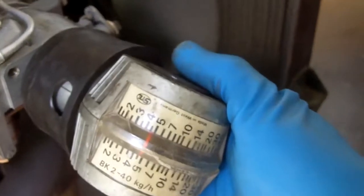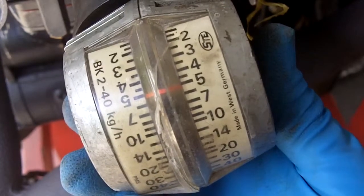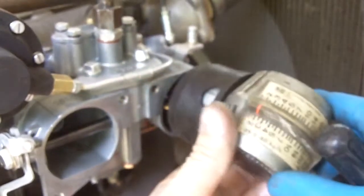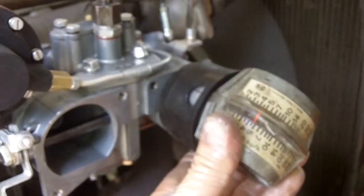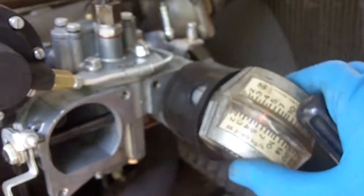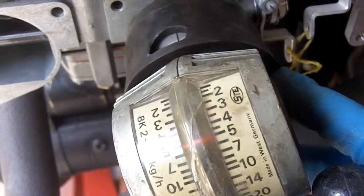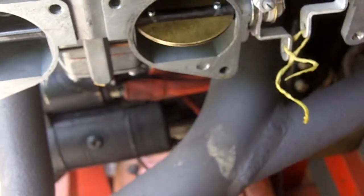Let me check our first barrel here. We're running four and a half. Get the camera closer — running four and a half. And here we are running five, just a little bit over five, so let's go ahead and dial this one up over here and get it up to where it's the same. Just a smidge above five. Let's see if this one changed any — a smidge above five. And we've got a solid idle at 1,100.